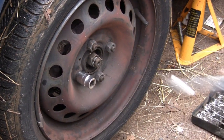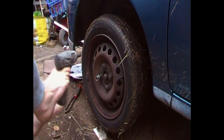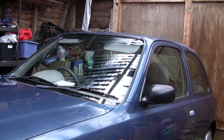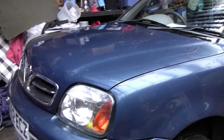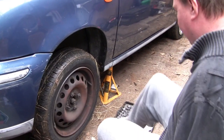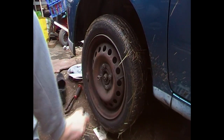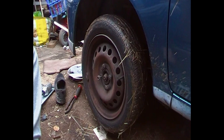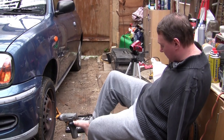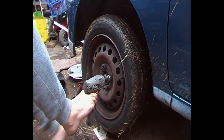Hi, welcome to my video on how to change brake pads and discs. This one is specifically a Nissan Micra but most cars are generally very similar. First you've got to jack the car up, which I've done to save time on the film. I'll put an axle stand under there for health and safety — it's good to do it just in case the jack fails.